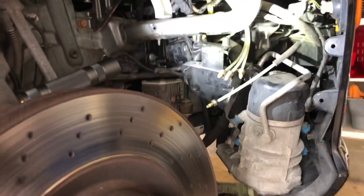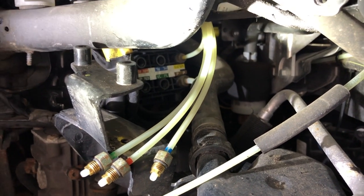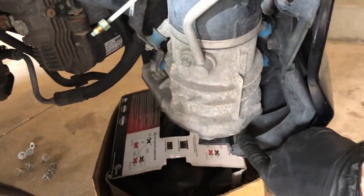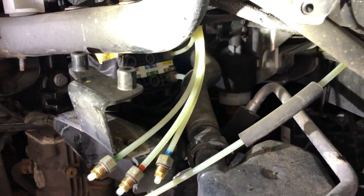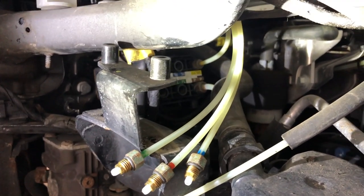The video quality isn't great here, so here's a quick update. I'm working through removing all the hose lines, cracking them a bit, letting the air bleed out, and then fully removing the lines. There's decent access to the bottom once you detach these bolts and swing it out. I've got this resting on the lip with a box under it in case it falls, but there's not much stress on these higher pressure lines. I still haven't been able to get the valve body out, so I'm going to disconnect the air lines and work from there.